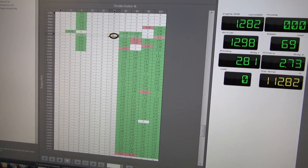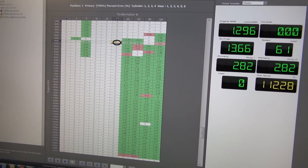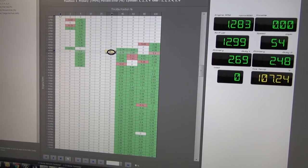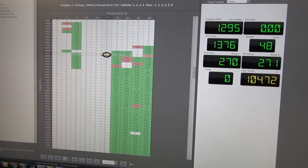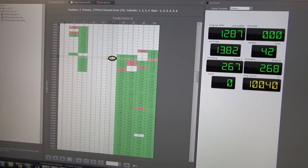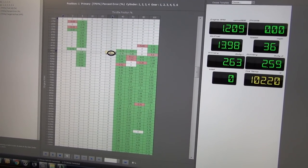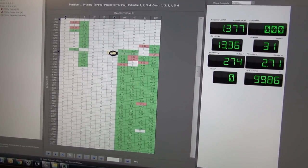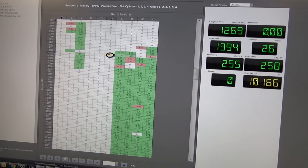This is a really nice program. We've been using TuningLink for years — it gives us a competitive advantage over our competition. I'm not trying to sound like a commercial. We provide this mapping with our exhaust systems — the Power Commander mapping at no charge. Of course it costs you to have your ECU flashed, and of course it costs you to purchase a Power Commander, but the mapping itself is free. We're using MR12 right now, which is great fuel. If another better fuel comes out tomorrow, we can go ahead and make maps and send them to you through our map support program — no charge, no hassle. So long as your engine is stock and you're running the same components we are when we produce these maps, you'll have exactly the same thing we will.